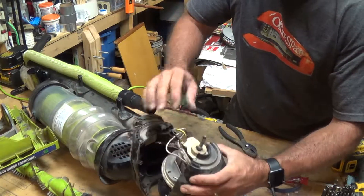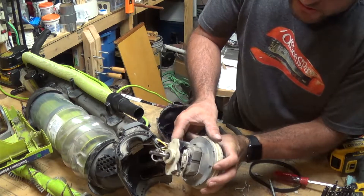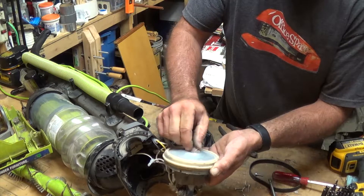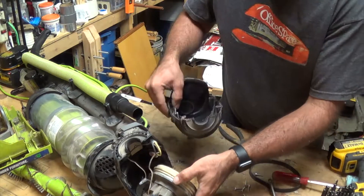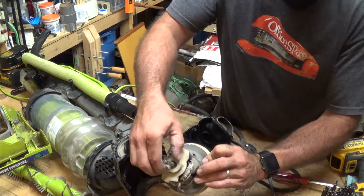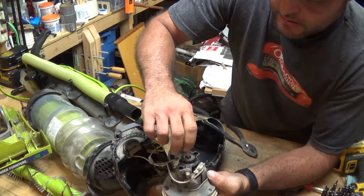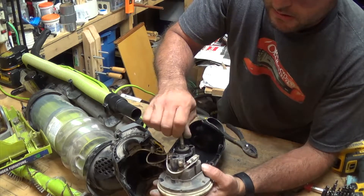Now what we're looking for in here — there'll be a couple of different things. One, we'll be looking for the brushes to see if there's anything left on those. They look okay. The other thing is all the crud that's in here — that's going for your fan, and it's completely blocking it. You also want to look around on the housing and see if you see where any of the bearings are. Nothing seems to be worn on here. Here we've got a sound dampener — go ahead and pull that off; it's actually for vibration. The bearings seem okay, although they do seem a little rough. There's a cover on this side — take it off.